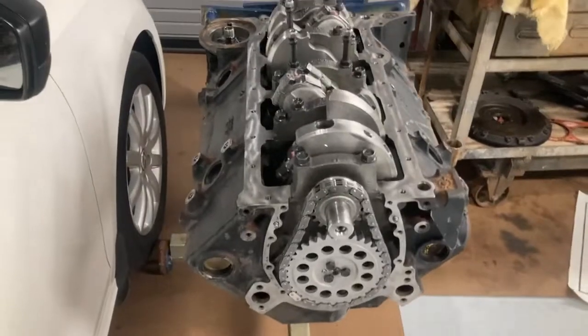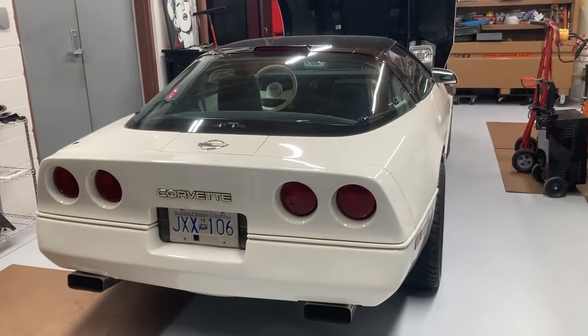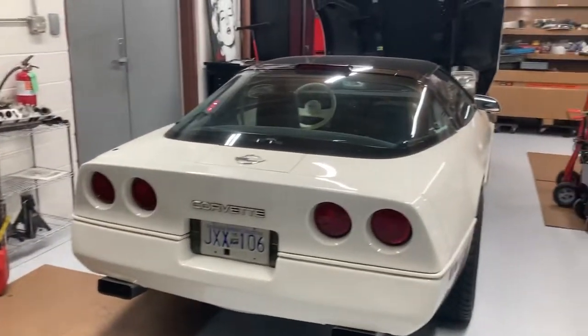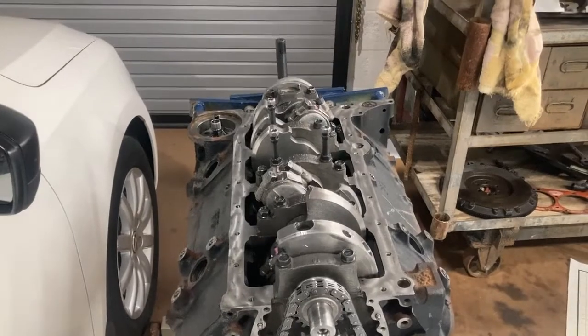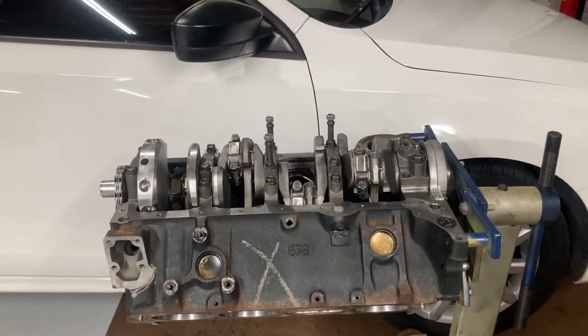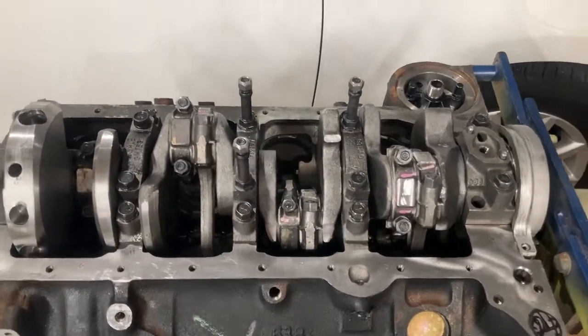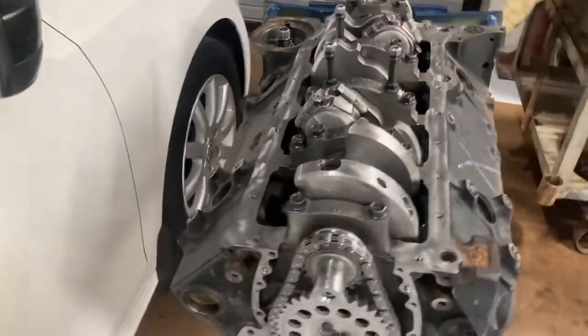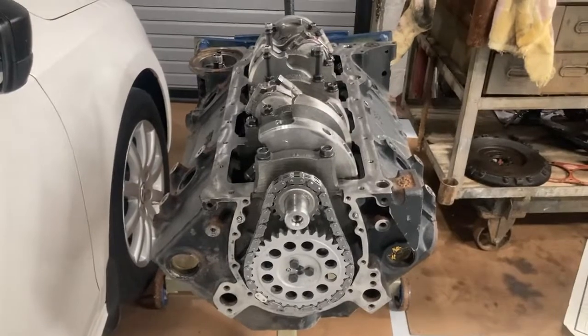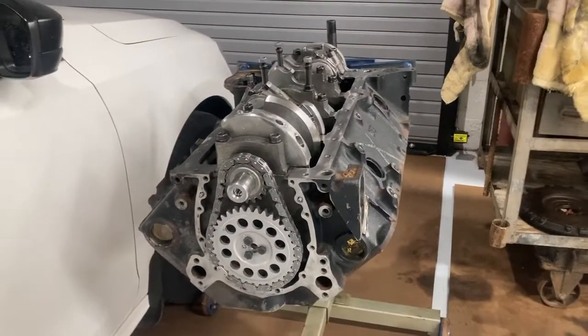This is the motor to the car. And don't fret, you Corvette originality nuts — I've got the original engine in a plastic bag sitting in my garage. So this is a ZZ3 performance engine that I bought when these things first came out. When they first came out, they had a set of hyper-eutectic pistons in them that were known to fail. So it failed pretty much right after install. I threw a fit and GM Performance gave me back a little bit of money on the motor — actually more than you would think — enough to put some pistons in it.